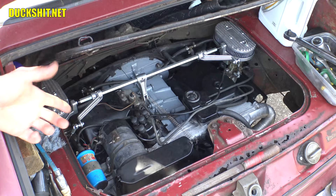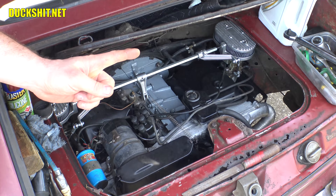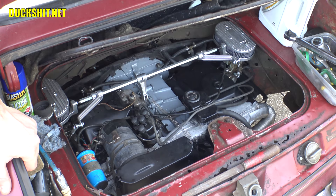It's just a weird thing. One of the push rods that comes out of the side of the carburetor that bumps the accelerator pump was actually hitting the side of the plate. So when I got to about 90% throttle, it would prevent that carburetor from opening any more — unless I pushed harder, which would cause the tins to flex. But that's going to cause something to break, probably my throttle cable first.